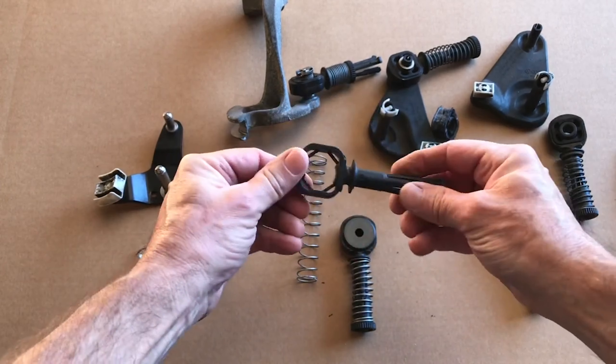On the oldest six-speed cars from the Mark 4 and Mark 1 TT, this pin wasn't an L-handle — it was just like a nail head — but it works exactly the same way. You push in a little bit and feel with the pin while pushing down, and when it gets into the home position it'll just drop in a little bit farther. Our selector shaft is now locked, the cable ends are open, and at this point we're going to go inside the car and lock the stick in the home position using the 5 millimeter alignment pin.